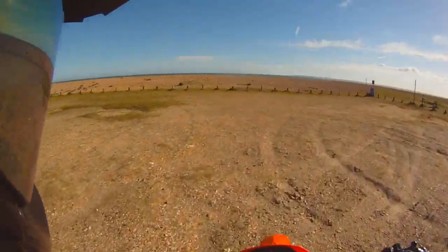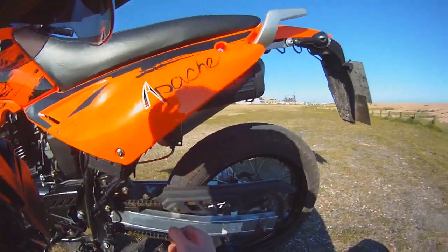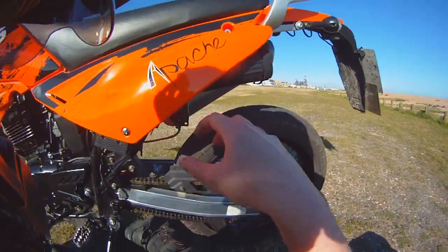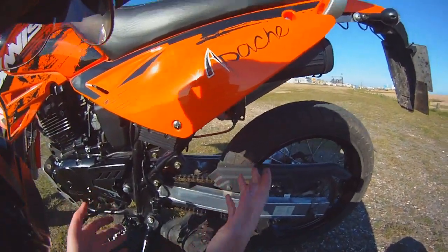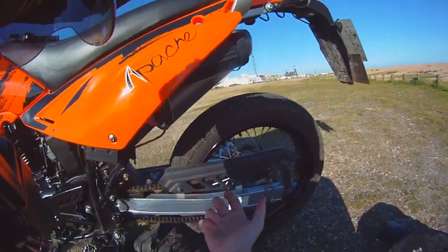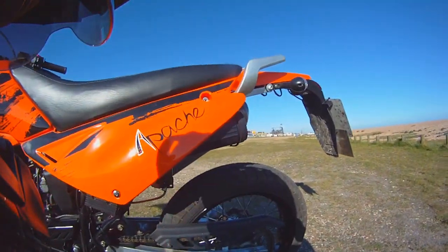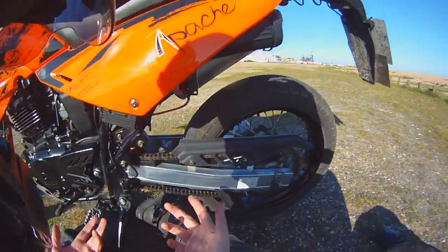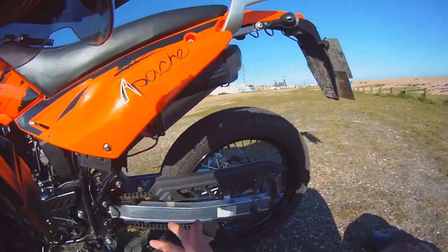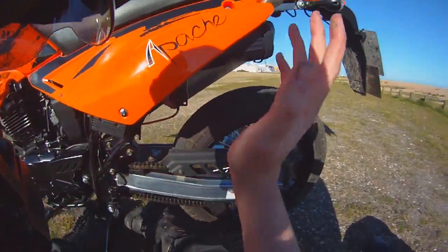So this is the oiler itself. I'm going to take this panel off to show you it more clearly. The reason I've mounted mine behind the panel — even though it is a top-filling reservoir and a bit more difficult to fill — is because on a supermoto I'm concerned about it being lower down where a bush or bramble could pull it off. Although it is harder to refill, I've got a large syringe and they give you so much hosing that you can just stick it on the end and pump oil straight in without taking it off the bike.